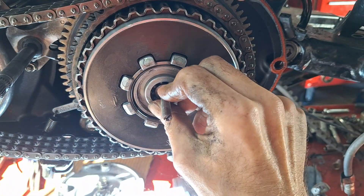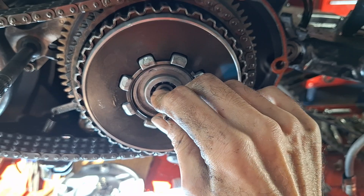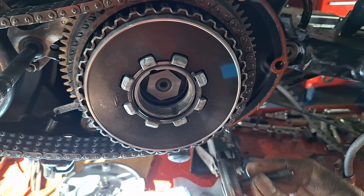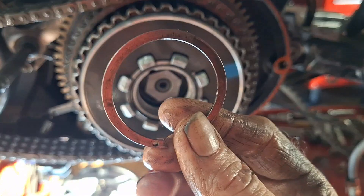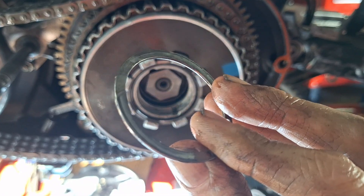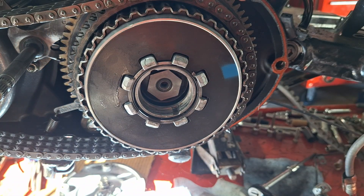You're going to need to pull the snap ring out of the pressure plate here. Draw out the bearing — it's just going to slide out. It's best practice to go ahead and replace this snap ring here; they do get deformed a little bit. I'll be picking up one of those when I go back together with it when I'm ordering transmission parts.